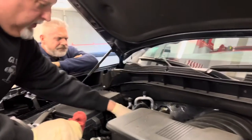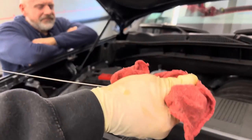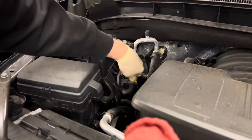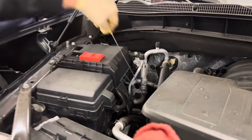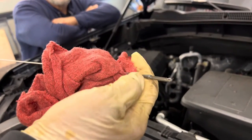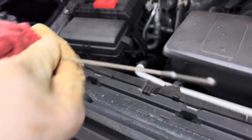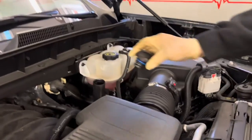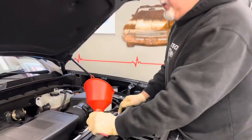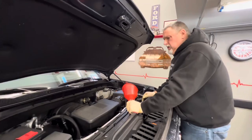We've got our oil dipstick tube on this side over here, so we're going to wipe it down and see what we got. We haven't started it yet, but I just want to see what the level is. It's full. We're going to start it, and as long as it stays within the checkmark where the middle of my thumb is, we'll be good. I've got the oil cap and I'll slip that back on. We're going to overlook everything — belts, hoses, all our fluid levels like normal — make sure everything looks good. That'll be it.